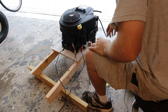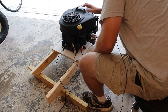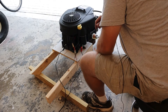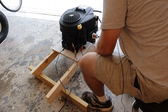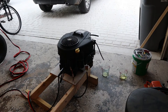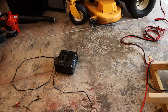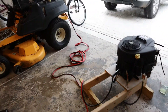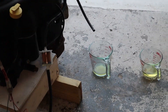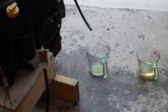I got some fuel to go through the fuel pump. Drive one more time. Try it again. Pull it. Now it appears our Bendix drive is stuck — never a dull moment with old equipment. Every time I start to film a video it starts to pour. My little battery charger didn't really seem to do much with this motor, so I hooked it up to my zero turn and was able to get the motor to turn over. As you can see, the fuel pump spat out some nasty-looking fuel. I think now it's safe to give it some real fuel, and maybe let the oil pump run a little and pump some oil through the motor.